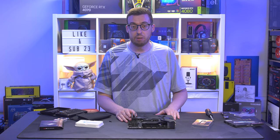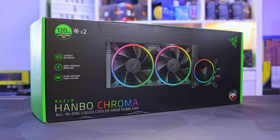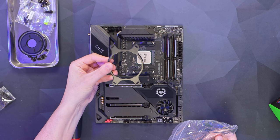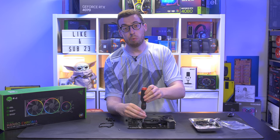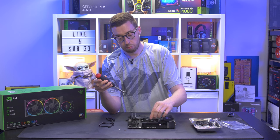Now we're going to get the Hanbo backplate on and then look at the case. I've already covered the Hanbo on the channel - there's a 240mm version and a 360mm as well. It's got a Chroma pump cap and RGB fans. We need to swap the bracket on the pump to the AM4 rectangular one, install AM4 standoffs, and use four thumb screws. I'm also working on a full install guide covering both Intel and AMD - get subscribed so you don't miss that.